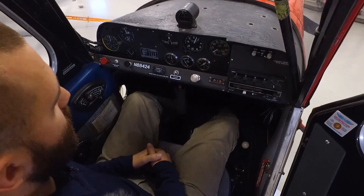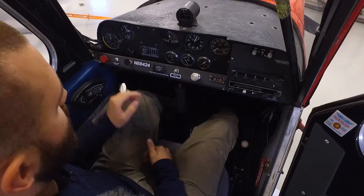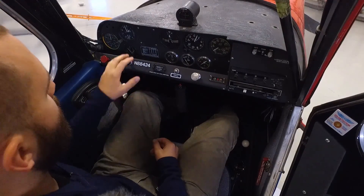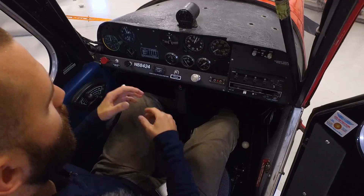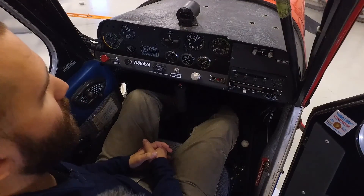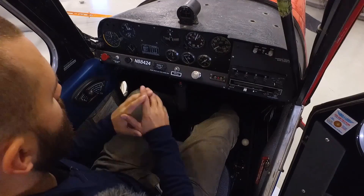A question for you guys that fly — if you're a student pilot or you've got your own airplane, do you check your gauges every time? Are you checking to make sure the airspeed is reading zero on the ground? Do you check to make sure the altimeter is within calibration of plus or minus 75 feet? These are all very important gauges, and the basics are critical — that's why they're the minimum required. Make sure you're checking your aircraft when you preflight to find out if everything is working properly, especially if you're renting — rental airplanes can be great, or they can be somewhat let go in terms of basic repairs. So make sure you check those over and make sure everything works.